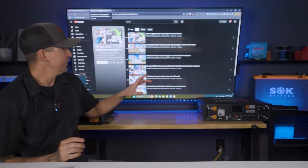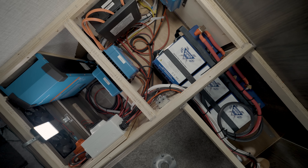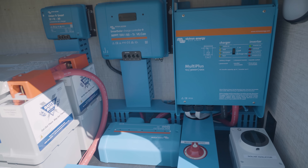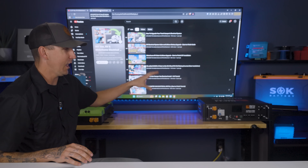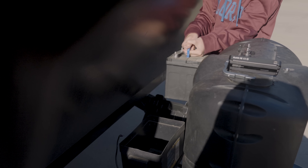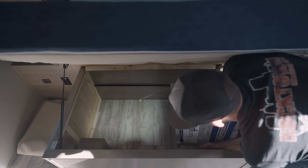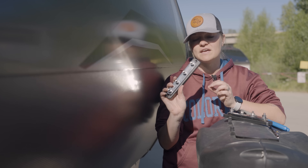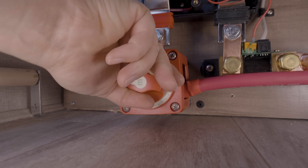If you've been watching this channel for a while, you've seen these videos where we upgraded the electrical systems in OEM RVs that already had their factory electrical system. During this process, we did a battery bank relocation kit, which basically meant that we removed the factory 12-volt batteries and then rewired the old battery bank with the new battery bank, so the new battery bank was directly powering all 12-volt loads.